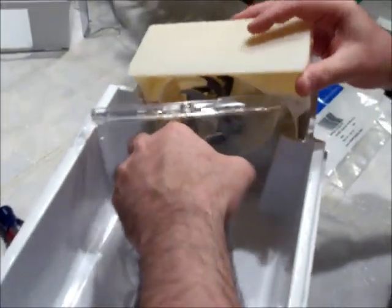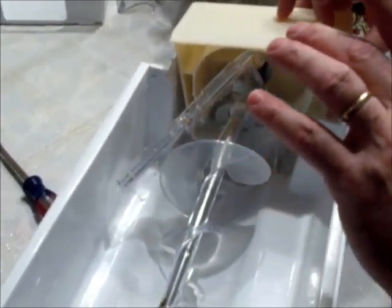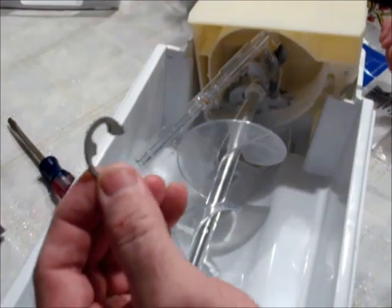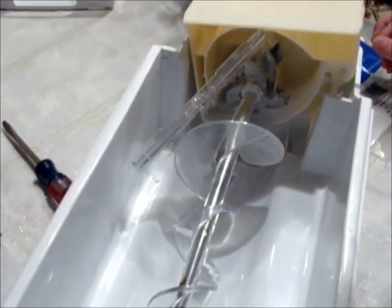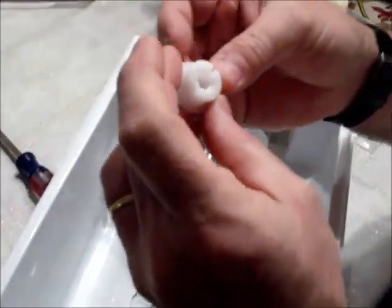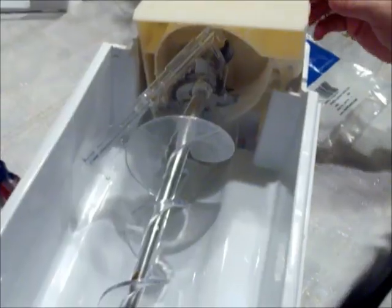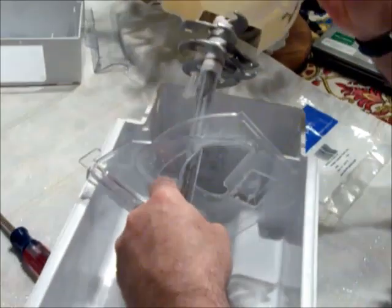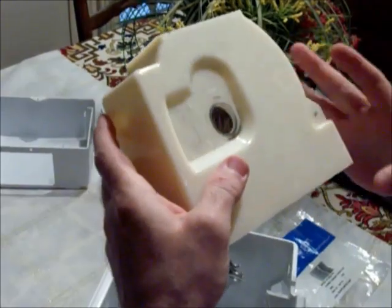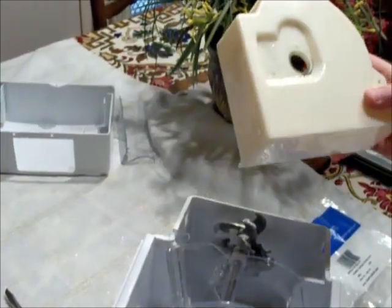Now the assembly is just hanging free. Because I mentioned that components could fall out — which is exactly what happened to mine — you could have this washer fall out, or this piece, or both. A real telltale sign is when the lips on this plastic come out. If any of those happen, you're going to have to replace this. I can pull it straight out because the washer and clip are gone — the clip should be right on top holding it in, but it's not.